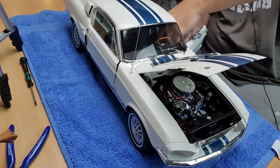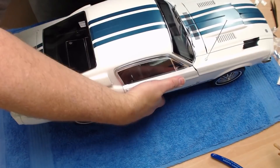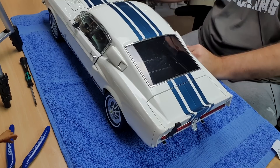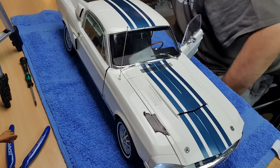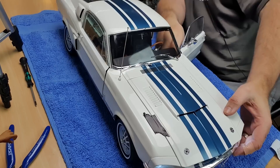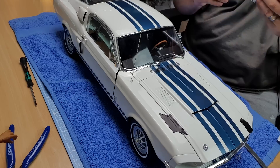You want to make sure that none of your seatbelts are caught — mine were here, so I'm just lifting that up a touch to get the seatbelt out. Looking good on that side. I'll put the bonnet down for a second and turn it around to check the other side. Seatbelts are good on that side too. Now I'm going to check the electrics again to make sure they're all in one piece — checking all the lights on at the front, all the lights on at the back, the horn works, the accelerator works, and the brakes work as well. All the electrics are working fine.